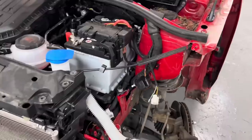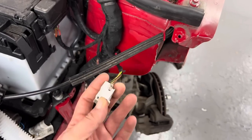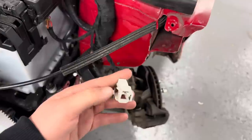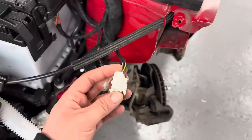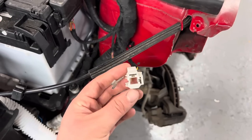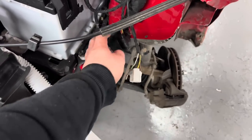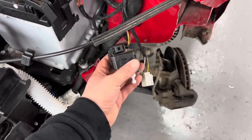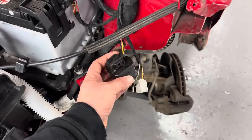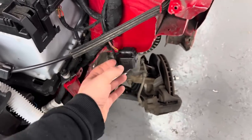I've seen one more thing that's broken — only a little thing. This headlight plug: as you can see, how this plastic is here, it should be like this on the other side with the terminal in there. You can buy these replacements from TPS. I'll order that tomorrow and just get these terminals out of this plug and swap them over into the new plug. This is the headlight motor to adjust the up and down of the headlight bulb — this does come with the brand new headlight, so this just needs unplugging and putting in the bin.